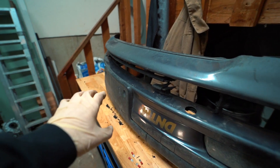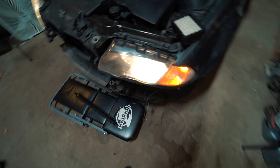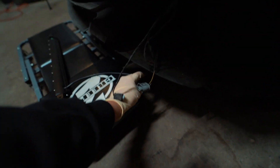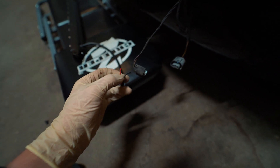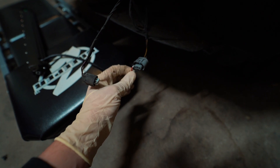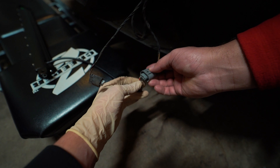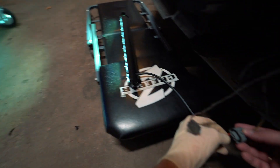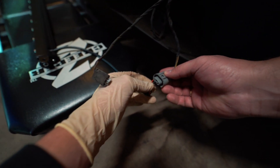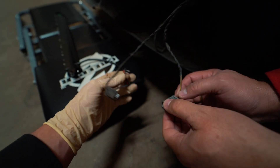The bar is ready to be mounted. I've got it down here and I'm checking the wiring with my fog lights on. The red wire is the hot wire from the light bar and black is the ground wire. In the E46 wiring harness, brown is ground and yellow-and-brown is the hot — and we get light. So the correct wiring is: red goes to yellow-and-brown, black goes to brown, and that'll power your light.